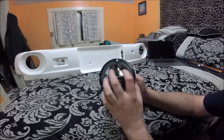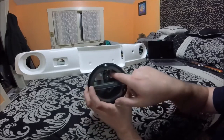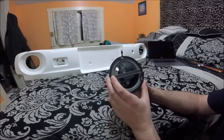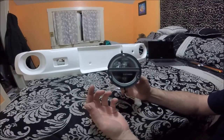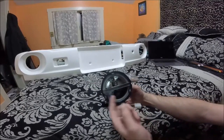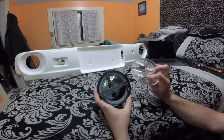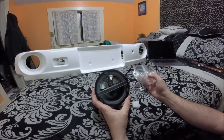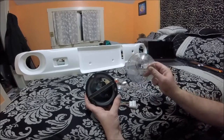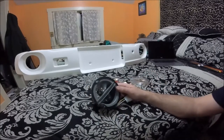This actually did not light up very much more at all when applying the brake, so I might end up wiring this extra small bulb into the brake wiring so that it lights up. These are probably pretty cheap bulbs and I am going to be replacing them with LEDs, so that's a little bit more money I've got to spend. I don't know how hot these bulbs might get with this acrylic lens, so I would like to play it safe with LEDs, and they will probably be much brighter as well.